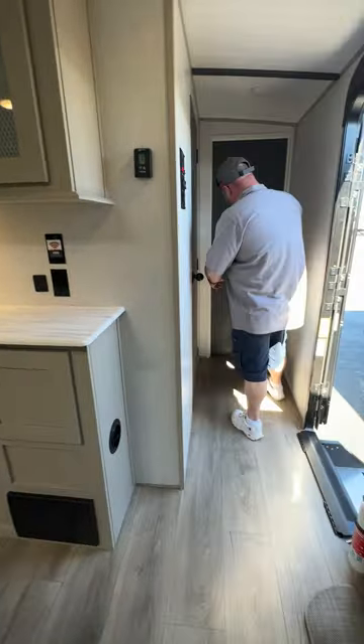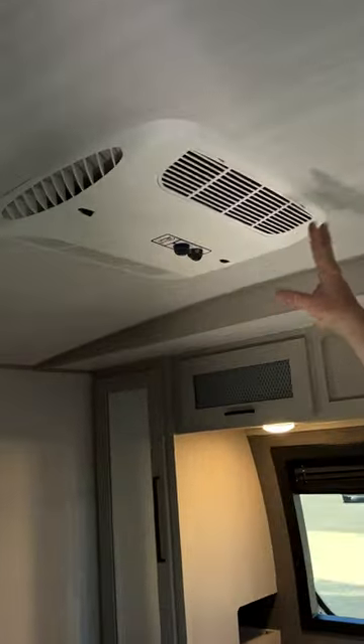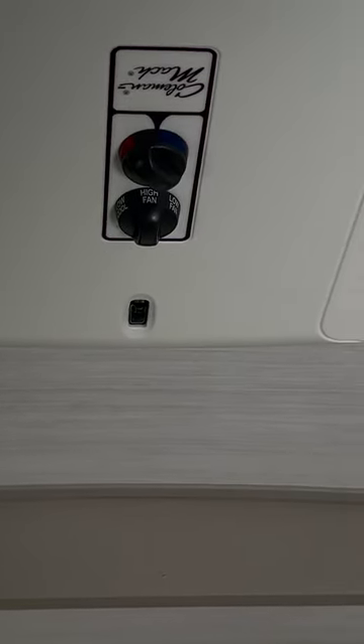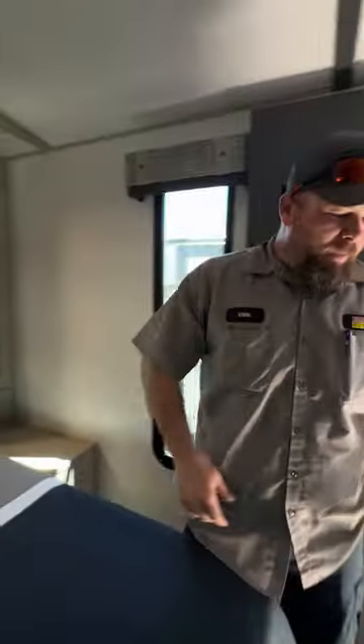The rear air conditioner, or bedroom air conditioner, is manual only. The control knob shows low fan, then high fan, then low cool and high cool. The reason it reads low fan twice is because these style air conditioners are designed so you can install a heat strip or heat pump to it and get some heat from the air conditioner. This unit doesn't have that, so your knob goes low fan, high fan, low cool, high cool. And then this is your temperature adjustment setting. If it's all the way down, it's just going to be on and running — it'll feel like an icebox.